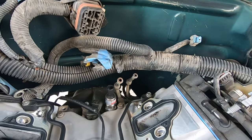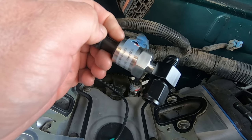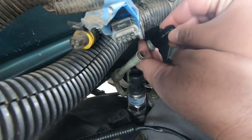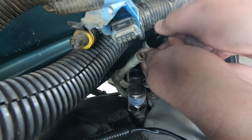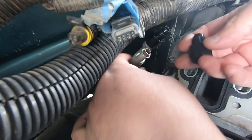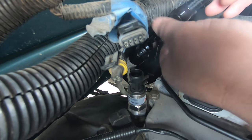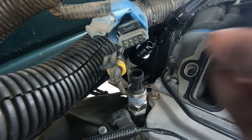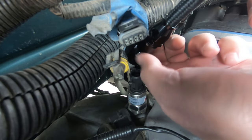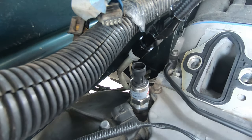I'm preparing for the future to run E85. I still got a little bit of rubber hose left so we got to change that first, but I will be able to fire this up on regular pump gas. This is just if you're running a Holley Terminator X - this is a fuel pressure sensor that I'm going to run and tap into the feed line. I'll do the smaller one first - this is the return - and then we'll do the bigger one, and this will be the feed.